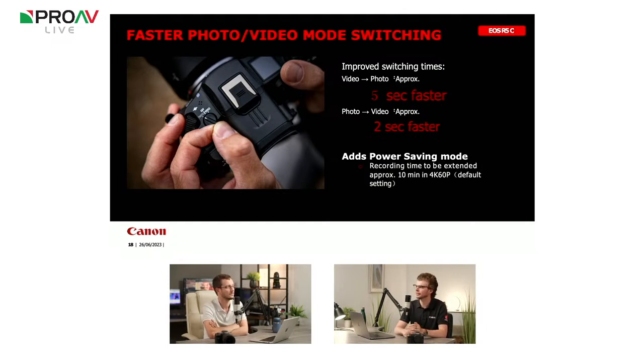And then adding to that, there's also now a power saving mode. So if you are in one of those situations where perhaps you're on your last battery or you just need that extended time, you can enable the power saving mode, which will give you an extra around 10 minutes in 4K 60 with the default settings. There's a few things it restricts in order to do that. You won't be able to shoot anything 8K or higher, and no slow motion, and no powering of external devices. So if you are using the Tascam unit or anything like that, it will restrict all of them just to save some of that power. But a good compromise if you do want that extended time.